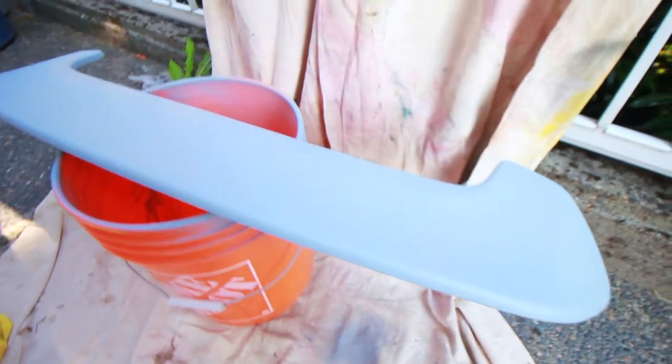Here's what it looks like after the second coat of primer. Obviously it looks really good on camera but in person it's not perfect because I'm doing it in the worst conditions possible. I can't afford to take it to a body shop — they'd probably charge me like two to three hundred bucks. So I'm just waiting for it to harden up before I wet sand it with a thousand grit to get it nice and smooth, and then it's ready for paint.